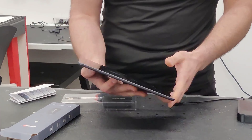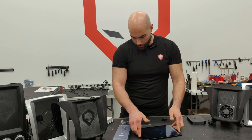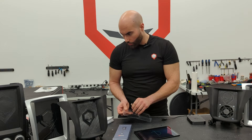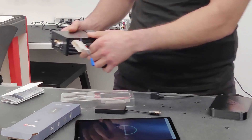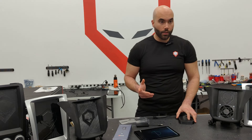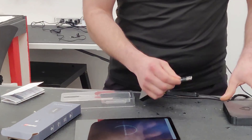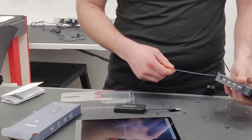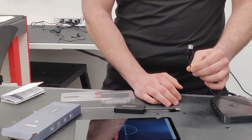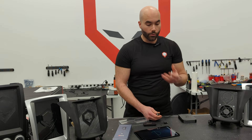What you're going to do is open up the AutoKit app. For those that have either the Mark 1.7 electronics, which are these, they already come with the four-port USB hub here, so you'll be able to connect your USB accessories. And if you don't have the Mark 1.7 electronics, you can actually use the companion kit. You're first going to connect the CarPlay dongle onto one of the four ports in the USB hub — you're not going to connect it to the one that has the extension on it.